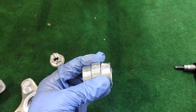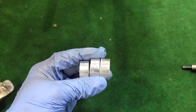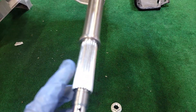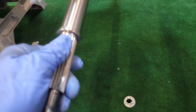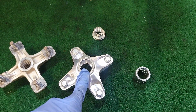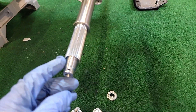These spacers make up the width difference depending on whether you're running it as wide as possible or a little more narrow. When installing, I'd recommend just a little grease or anti-seize on the mating surface, especially since these are dissimilar metals — a steel axle and aluminum hub — and then thread sealer on those threads.